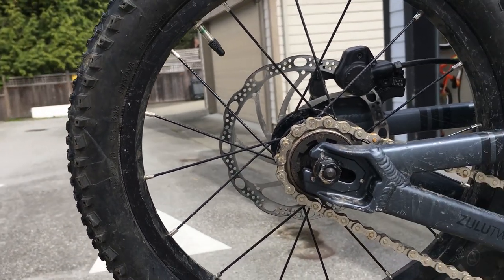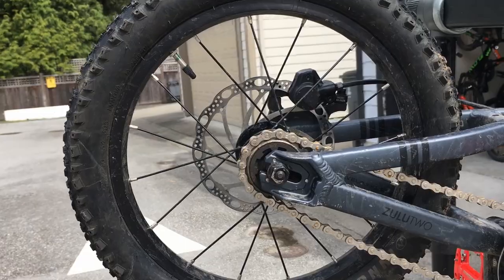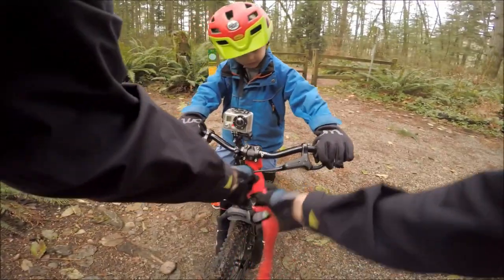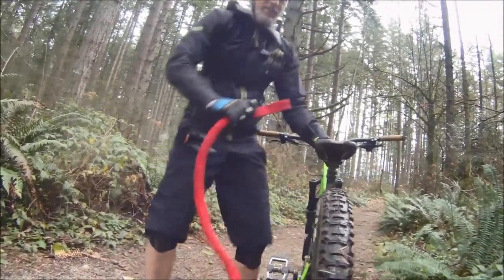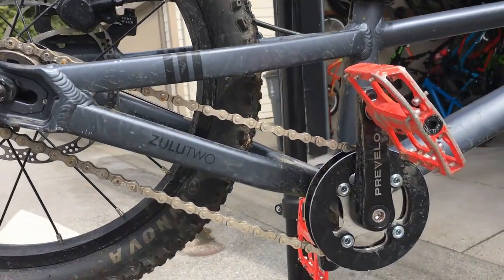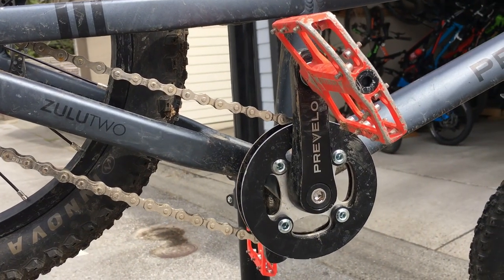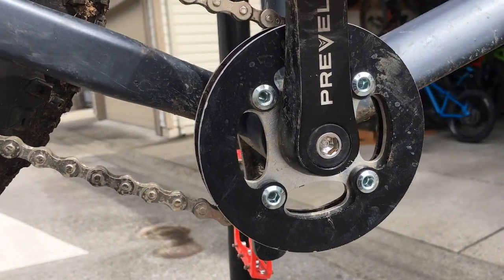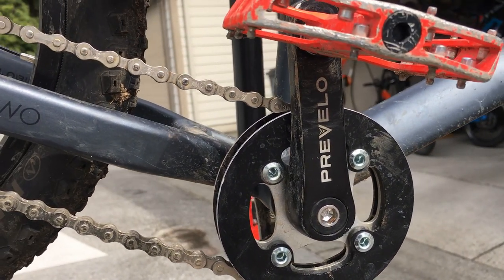There's no gears on this bike, and that is just fine with us. Get yourself a tow-y. Kids in this age really don't like to climb, so you're going to be towing them up anyways, so there's no need for the added complexity and weight of a derailleur. It's a 25-tooth front chainring and a 14-tooth rear cog. These 95-millimeter custom cranks are so cool — they keep the pedals from pedal striking.